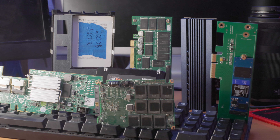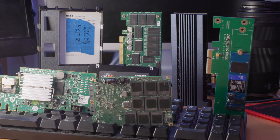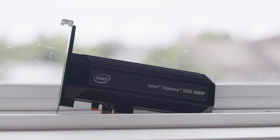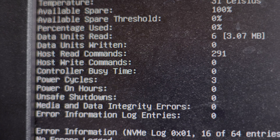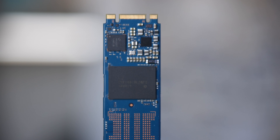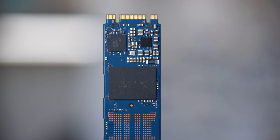First I want to go over the technology that Optane SSDs use and how they differ from more traditional NAND flash-based drives. Optane SSDs are typically a lot faster and more performant than NAND drives. They have much better Q-Depth 1 performance with a lot lower latency. They also do much better in terms of writes, with write endurance often 10 to 100 times better than a NAND flash-based SSD. They also have a lot less overhead under the hood — there's no concept of an erase block, and they don't need a DRAM cache to maintain their high speed.